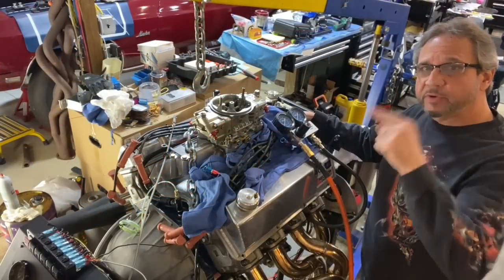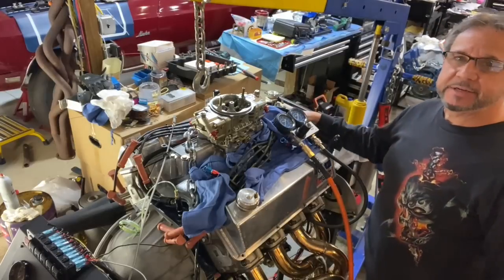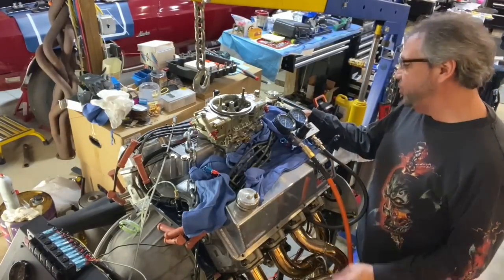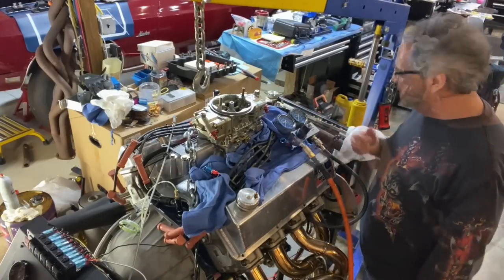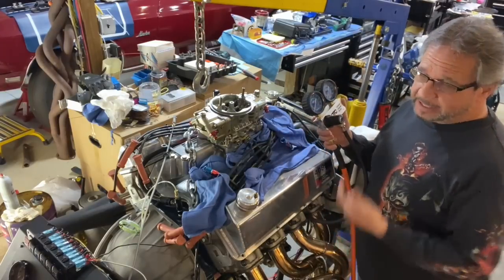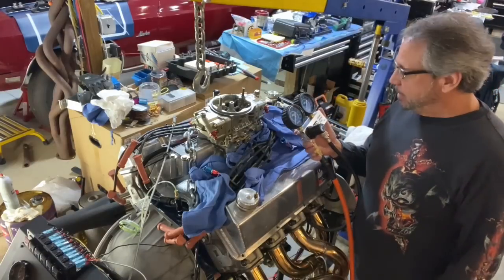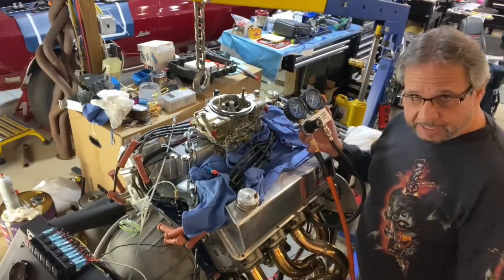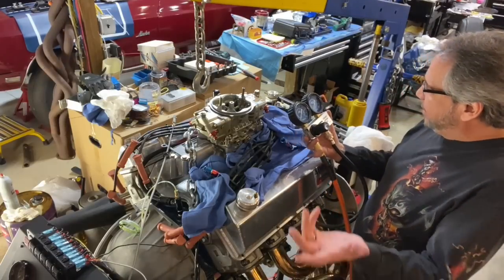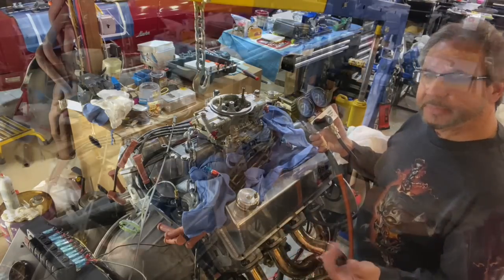I'm not going to go through all the setup — I'll just explain it as we do it. The theory is: you have air coming in at a set pressure. You don't want to go any more than 100 psi on this gauge set. You read the difference between the input and output — that difference tells you the leak down percentage. Twenty percent leakdown means you've got an issue; fifteen percent and you better be thinking about it. I'd like to see maybe six to eight percent. It's a fresh motor on one hand, but the rings are used, so let's put the pressure in.